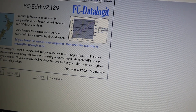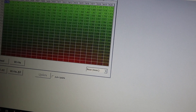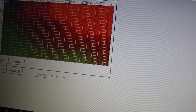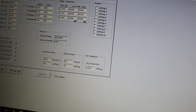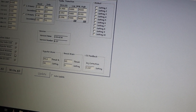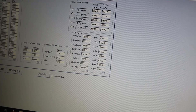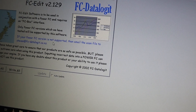Now that you've initialized, click on Read All. This will give me the map that is currently on the car — this is the base map that came with the Apexi Power FC. I'm not going to bore you with all the settings, but basically you've got your injector map, a whole bunch of timing tables — leading, trailing — your base map, and then your settings: basic things like rev limiter, what sort of boost you can run. Mine was set to 0.8 bar previously. As you can see, this is definitely the stock map — sequential turbo control is still on, O2 sensor control was switched on, and there's a whole bunch of other settings for water tables and water heat tables. Anyway, we're not worried about that whatsoever.